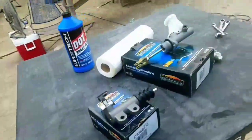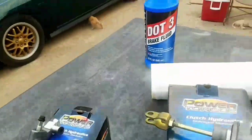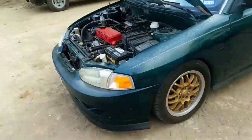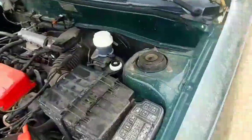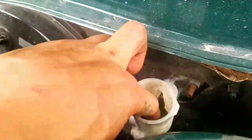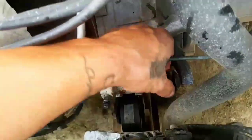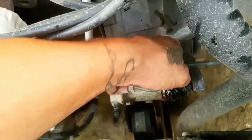What's going on guys, today I'm going to be replacing the clutch master cylinder and the slave cylinder on the car. I also got some DOT 3 brake fluid so I can add some new fluid to the new parts. This is the old sludgy oil that it had. The reason I'm replacing both of them is because this slave cylinder just failed on me yesterday as I was driving the car.